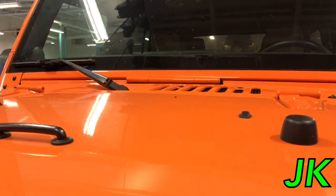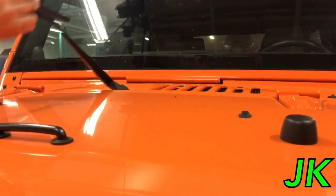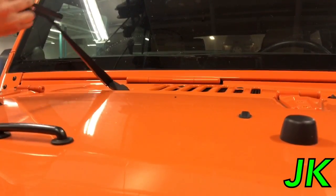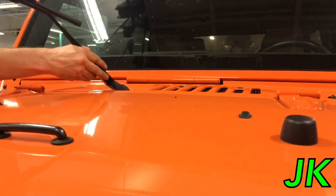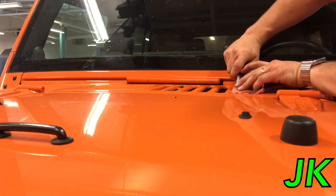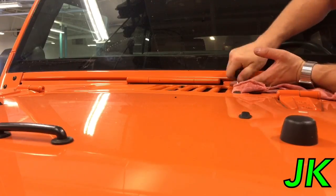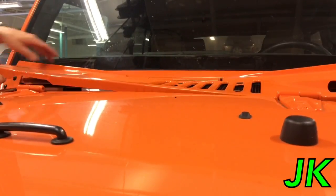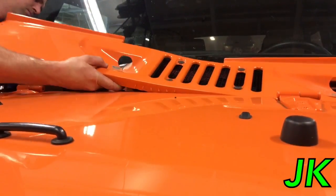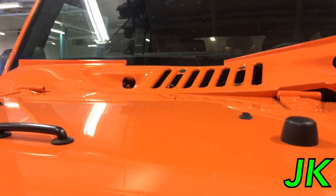I've already started to take the wiper arms off. Here's a little trick: once you get the nut off, put the wiper arm in the up position and jiggle it — it will eventually come off the shaft if you give it just a few seconds. Now just a heads up: this cowl is not easy to get off. These plastic rivets are a pain, and getting the thing up is aggravating, but you might have to do it if your drain is clogged — and you'll know your drain is clogged when your floorboard is wet.